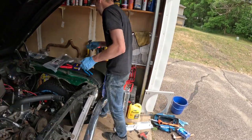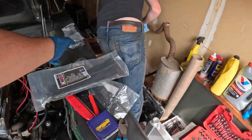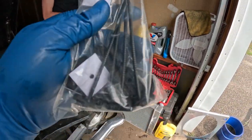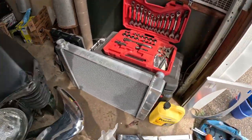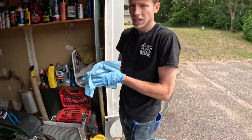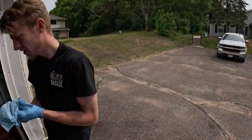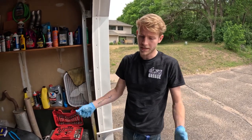So next step, you get the radiator. Right in here. And then this kit, they say what they got here. I'm going to show the people. These go right through the radiator fins, and then there are foam pads that you stick between the transcooler and the radiator so they don't rub metal on metal. I hate that idea. Personally, I think you're asking for something to happen. You ideally want to separate with some form of bracketry coming out from the radiator. You've seen people do this on a motorcycle. They work. That's why they sell it. They wouldn't sell it if it didn't work.